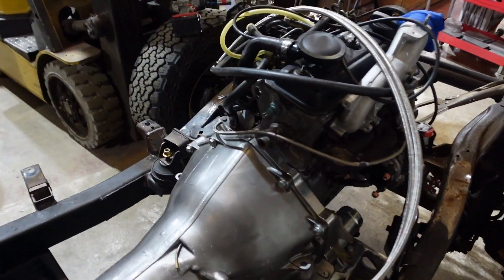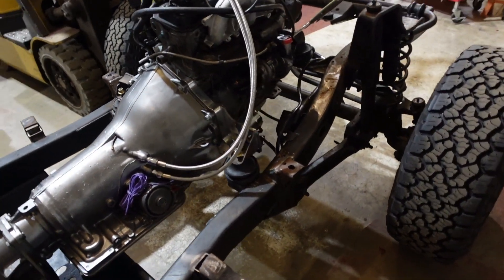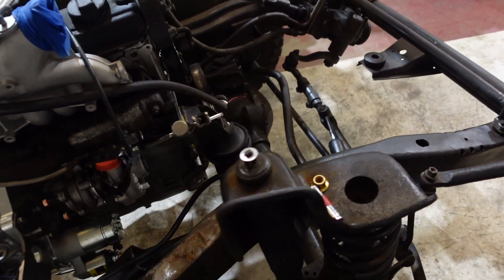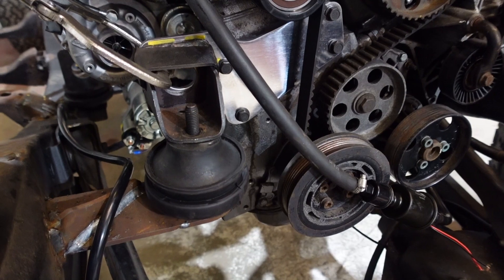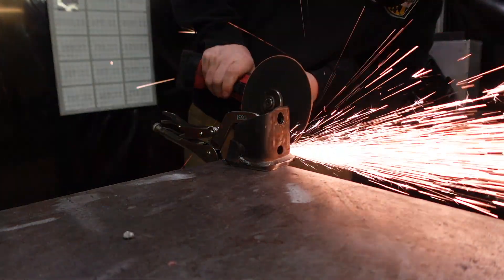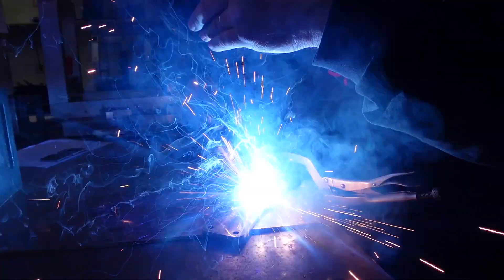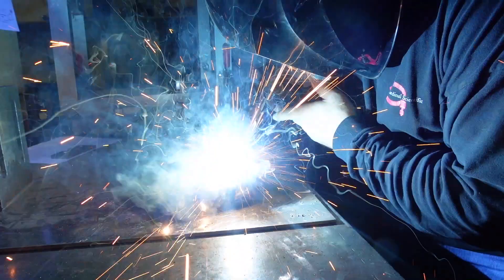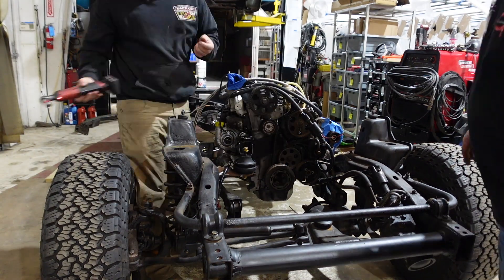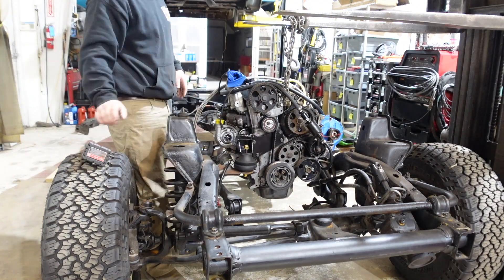On the motor mounts, we have this motor mount and the front motor mount. We ended up adding another rear motor mount so it's even on both sides, and then we have the front one — we had to cut it off and weld the piece we cut off to a new plate, then it goes right back where it was. We saw some of your comments saying the motor was shaking a lot when we had it running, so we decided to follow your advice and add more strength to the motor setup — adding a rear motor mount as well as a front motor mount on each side. When we added the rear motor mount it put too much weight off the rear, so we had to adjust the front one, but now that it's dialed in it should be ready to go.